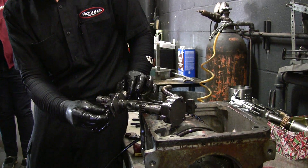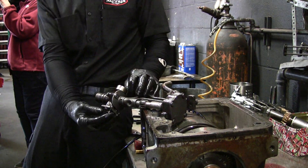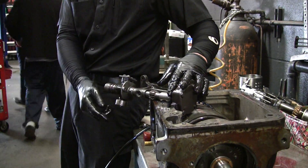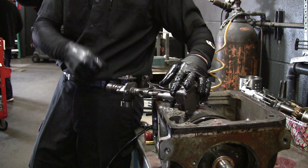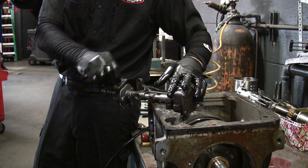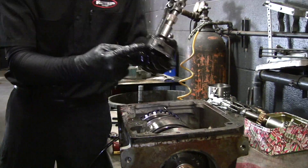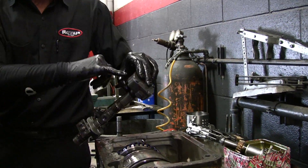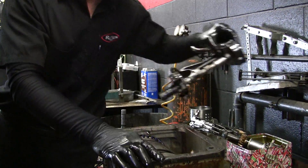Here are your two governor valves that go in and out. Like the two governor valves — when this spins, see how they go up and down? This is the first gear shift because it's a big, heavy valve. At a low speed it's going to be out there. And then there's a pump in here — it looks like an oil pump inside. It sucks and goes to this pipe that goes up forward to that front servo.